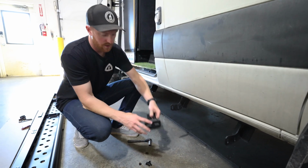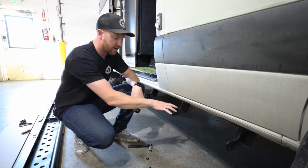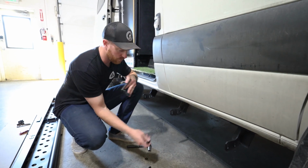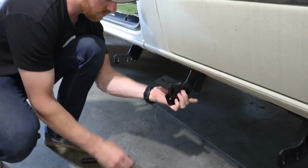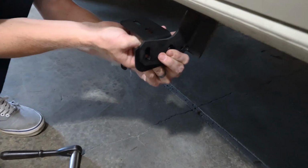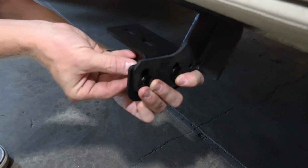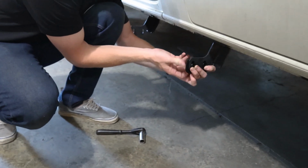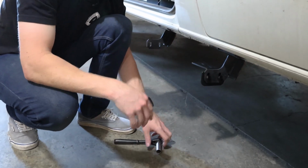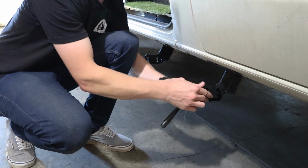Next up is to get the brackets mounted to your Revel brackets. These are the ones that come from Winnebago already on your van when you take off the other steps. These are our brackets that mount to the holes. There's carriage bolts, so you go carriage bolt through in here, a washer, and then a nylock. This second one through in here. So we're gonna get all these brackets put on, and you wanna leave them a little bit loose. You'll see there's some pill slot adjustment kind of in all directions in there. So we'll get these on there snug, but you wanna leave them loose so when you get your side step on, it'll all even itself out and then come back and tighten everything down. So we'll get these snugged up.